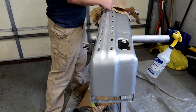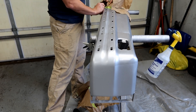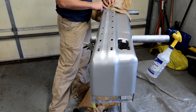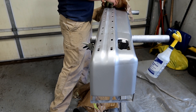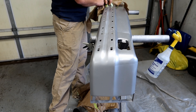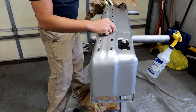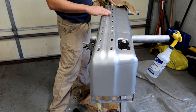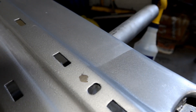One of the things I've struggled with this whole time — I had this bumper sand blasted, but it didn't really remove a ton of the chrome finish that was on it. I've always been fighting that — what adheres and what doesn't, what primes and what doesn't. So it looks like we peeled some paint off and there's chrome right behind it. Good news is our bumper strip is going to cover that up, but I'll probably still touch it up with some paint.